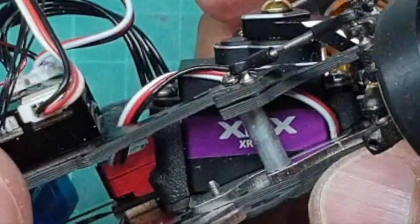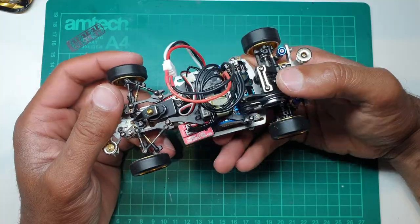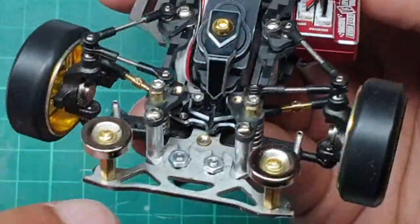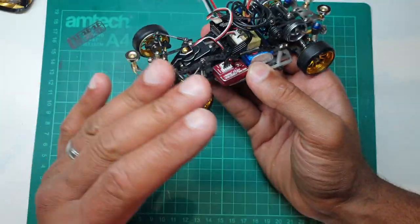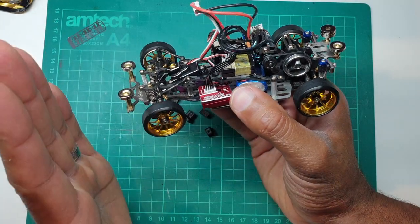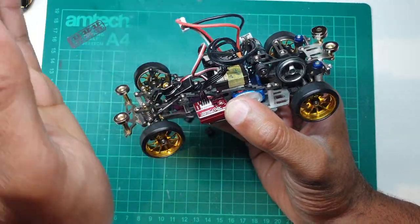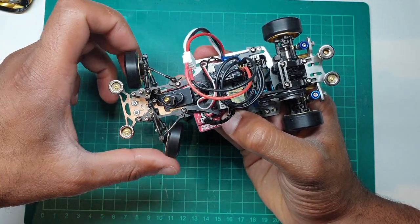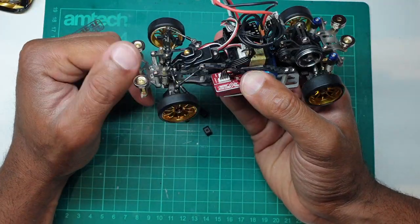Sorry about the mess of wires — the motor turned out to be faulty and I had to strip everything and redo it. The actual servo itself has an aluminium arm, and also the ends of the arm are aluminium. Adjusting the angle of the servo allows you to change the angle at which the steering engages — so if you're adjusting the caster of the wheel, you can adjust the servo swing angle to match the caster. What that gives you is a much smoother steering and instantly full lock, no questions asked.